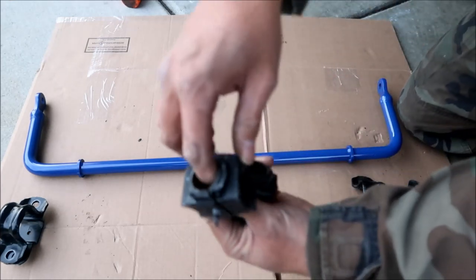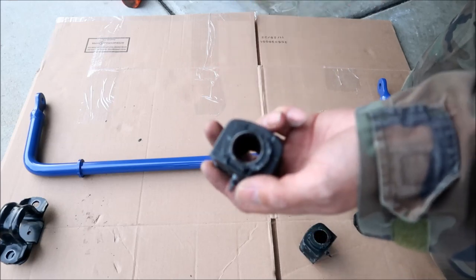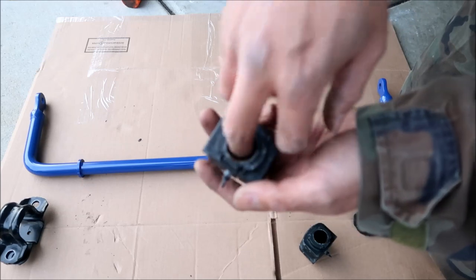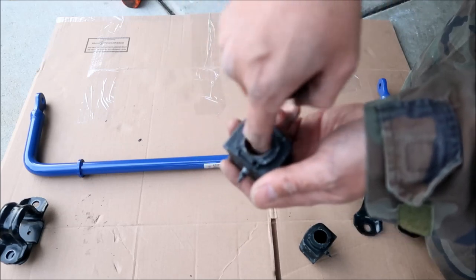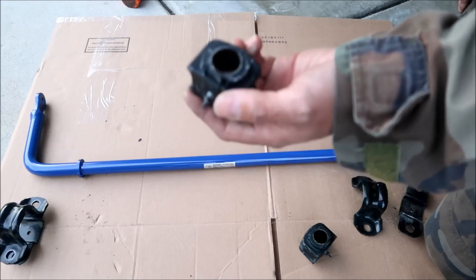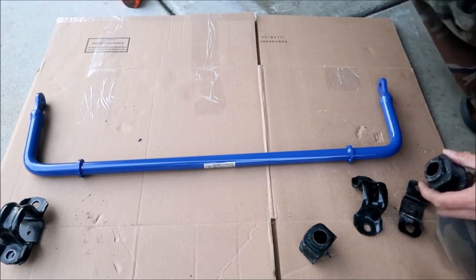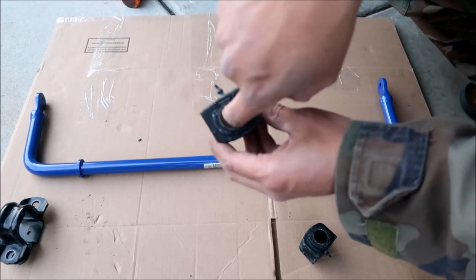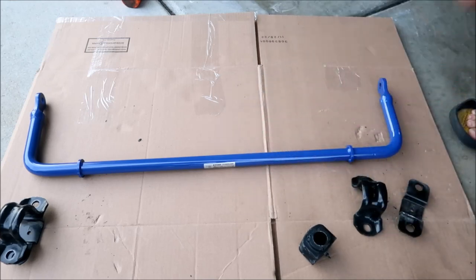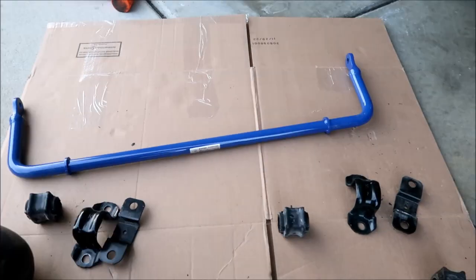There's a little sleeve in here. Some sway bars require grease, but the repair manual didn't mention any grease, so I don't think you put any in here. No grease came in the box either, so I think you put these on dry. It has a special fibrous material inside that lets the sway bar slip around. I'm going to install it dry — that's how we found it.